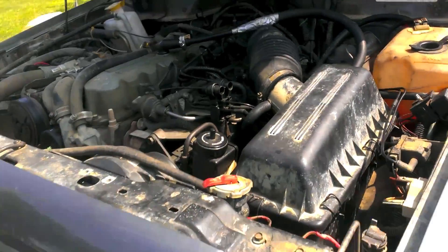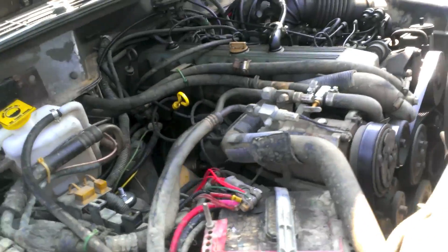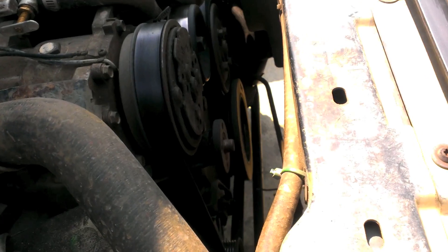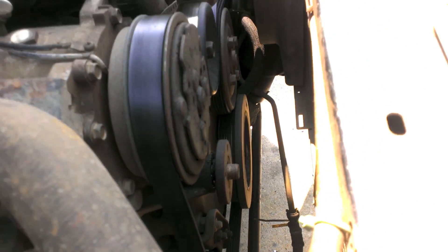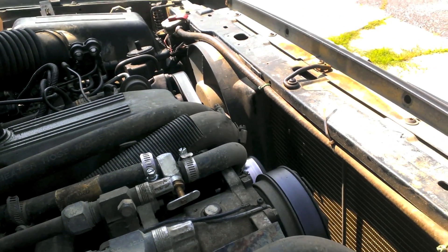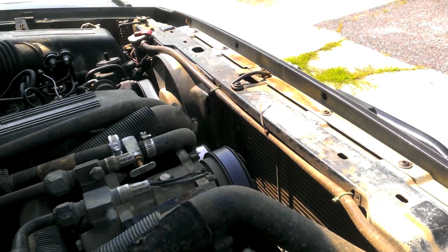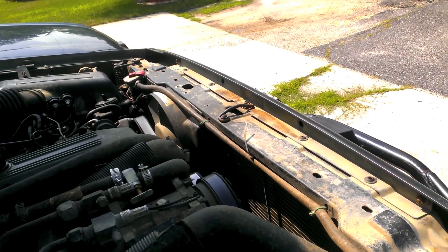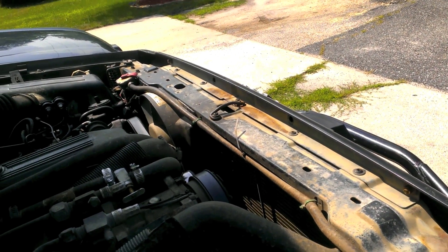Back in the Cherokee. Now that everything's running I can finally drive it and figure out what kind of drive issues I'm having. Since I deleted my mechanical fan because the bearing seized, I'm relying completely on the electric fan to keep cool. It was fine in the winter, but now that it's summertime, if this idles for a while or sits at a red light, it will start to creep up past 210.